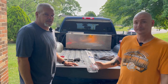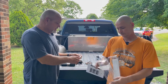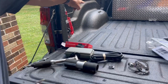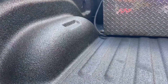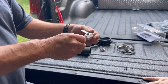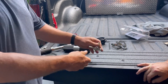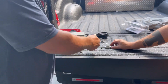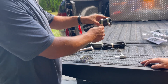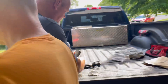RDS makes a lot of tanks — I have an RDS tank and the RDS install kit. This is the ball valve that screws into the side of your tank, almost like a drain plug. You can see on his tank he's already got one, so this would just be a spare. You thread it into the bung on the side of the tank — that's closed, that's open. You get four clamps and put two on the truck side and two on the inside. Once installed, make sure you check for leaks — put fuel in your tank.